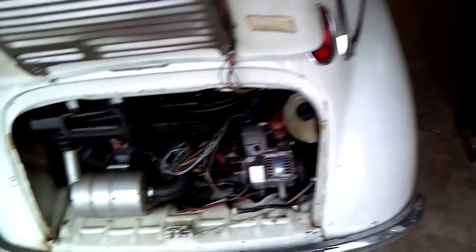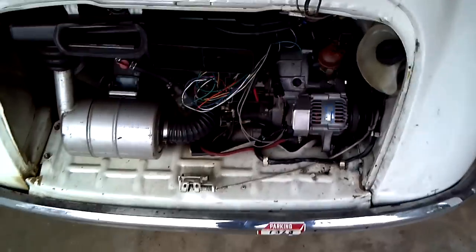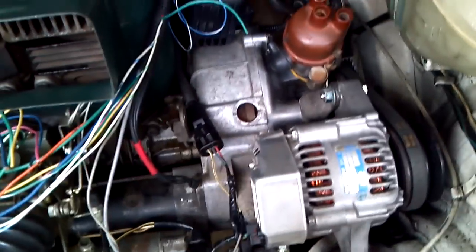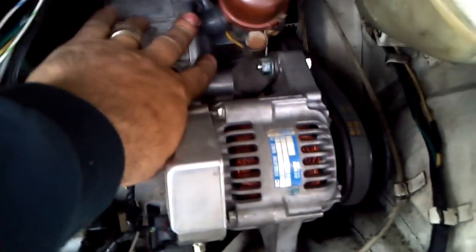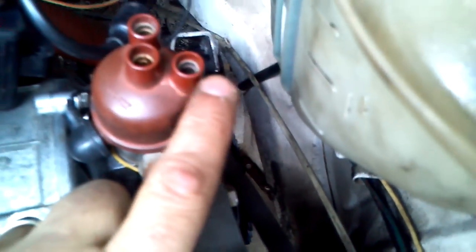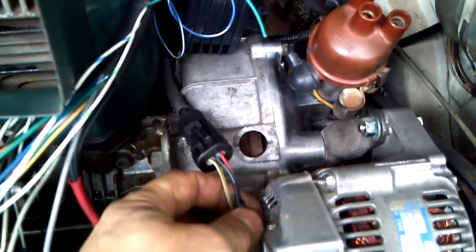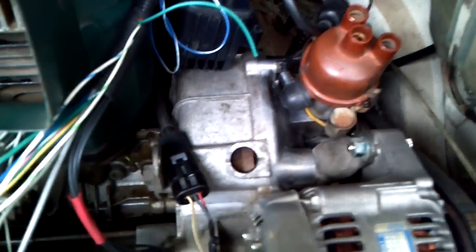What I did today was I ran the wiring harness from the front to the back and started wiring in some circuits. Last week I installed my spare clutch housing cover outfitted with a 36-minus-one timing wheel and hall effect sensor, plus the bracketry — so that's all tied in now, running through this line here. I still have to put a loom on it to protect it, but it's hot-wired up into the computer.